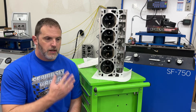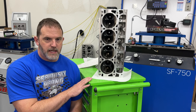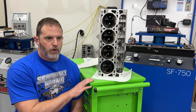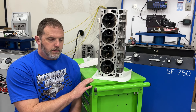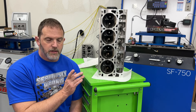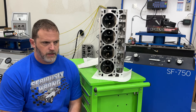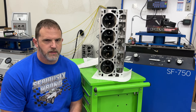Last week the camshaft was supposed to arrive next day but didn't, so I couldn't talk about it then. Gary Dunsworth at Dunsworth Machine was kind enough - the engine was still on the dyno Monday morning, the camshaft showed up, I put it in and we dyno tested. We also tried the Dominator, some timing changes, just to see if there was any effect. That 243/246 on 108 had about 620 lift - same lift as the Texas Speed, just way more duration on intake, less on exhaust, and a tighter lobe separation.